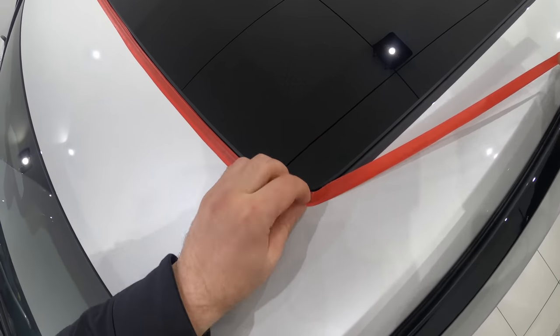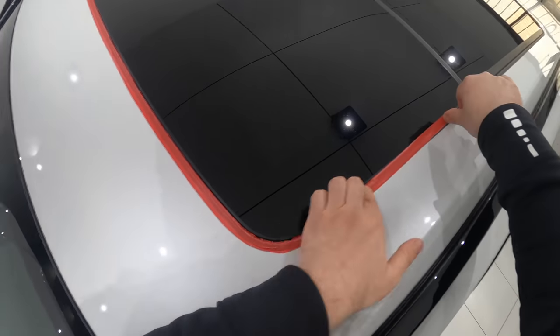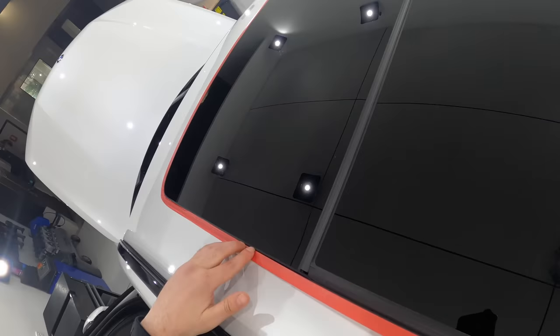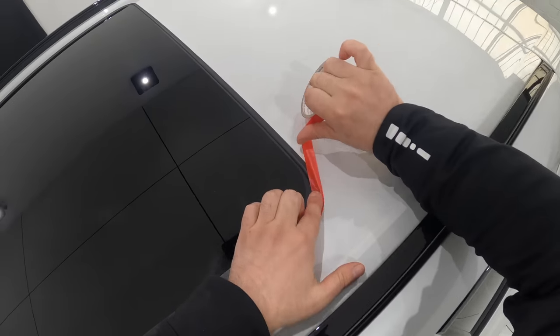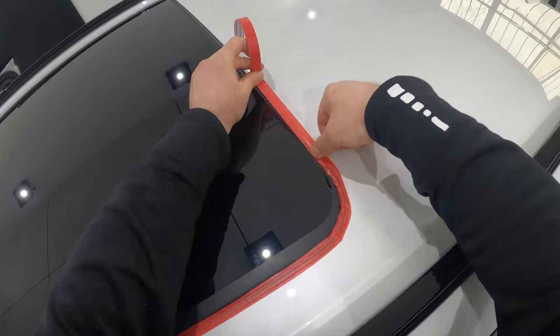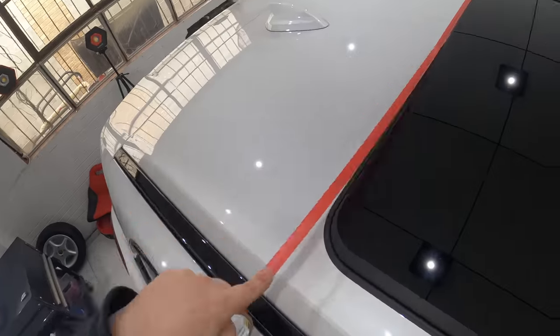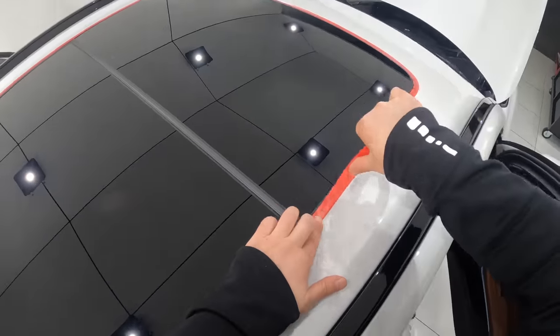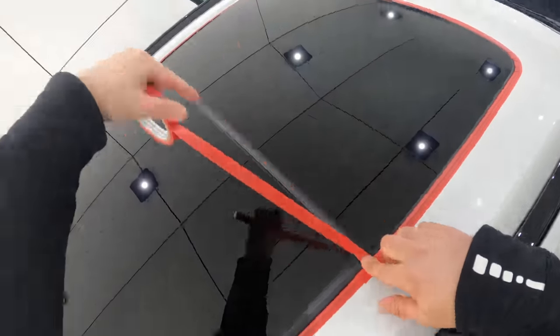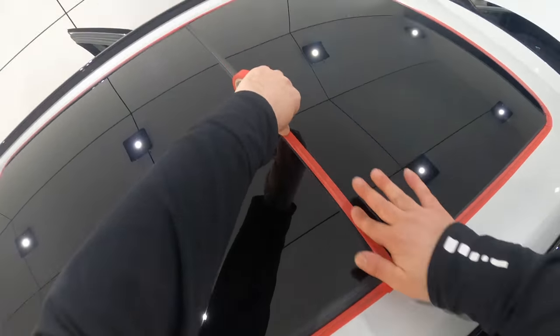I guess the advice I'd give here is to try and place it precisely and tuck the sides of the tape into the trims as best you can to avoid picking up adhesive residue from those edges when you polish over the tape. But if you get it wrong, just pull it off and try again. Masking is pretty forgiving that way. Also, make sure to press it down after you apply it to make sure that it won't pull up during polishing.